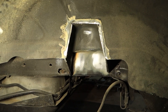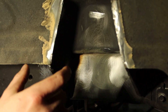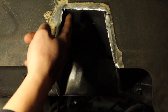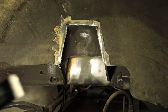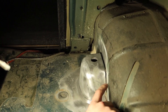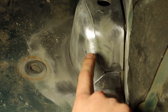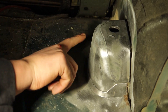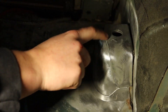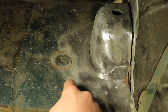So we're going to start off with just stitch welding. I'm going to stitch weld inside of these two ears that hold the rear strut tower to the frame rail. And then I'm going to stitch weld right here, connecting the wheel well sheet metal to the strut tower — that's what I'll do for the outside. On the inside, the wheel well is separate from the strut tower, so I'm going to stitch weld all around the top. This heavy duty piece of metal on the very top is just spot welded, so we'll stitch weld around both left and right sides. Then I'll stitch weld a little at the bottom and do a couple stitches to connect the trunk floor pan.